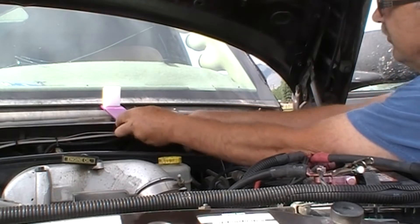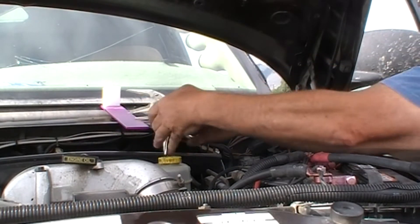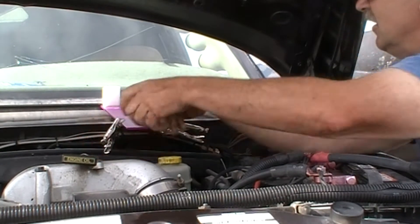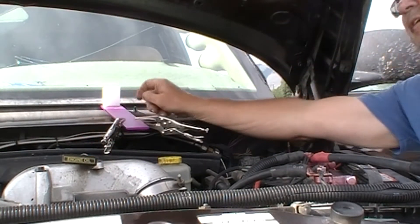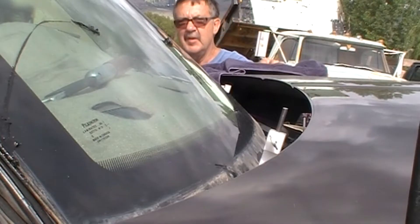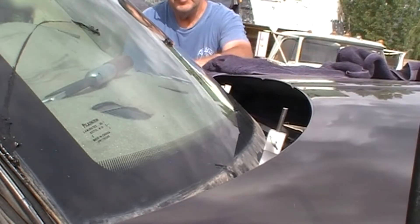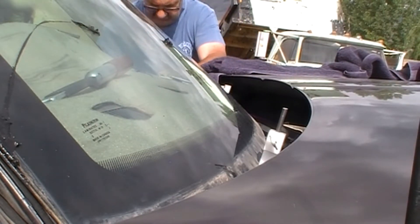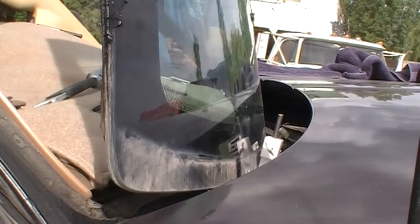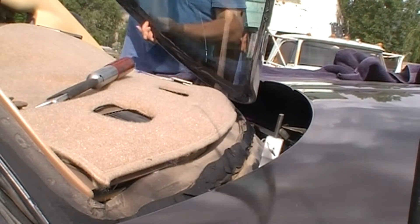The glide block is set up just like the setting block. As simple as it looks, it acts as a setting block as well as helping you remove the old windshield — a great benefit especially on a tall vehicle. Take advantage of the glide block by placing the windshield in the groove of the glide and sliding the windshield out with ease. No need to stress your back. Let the setting master help you.